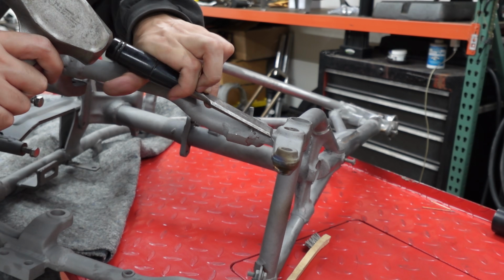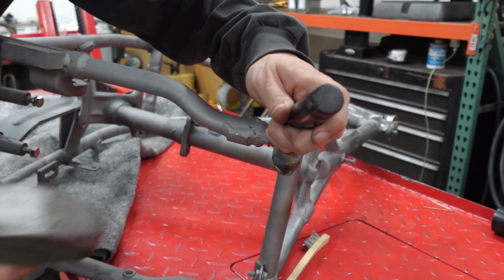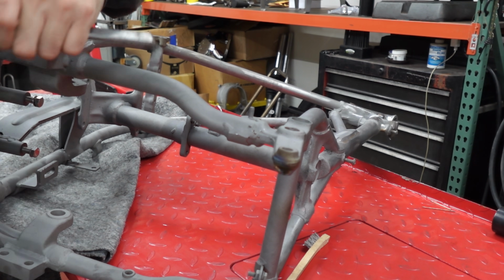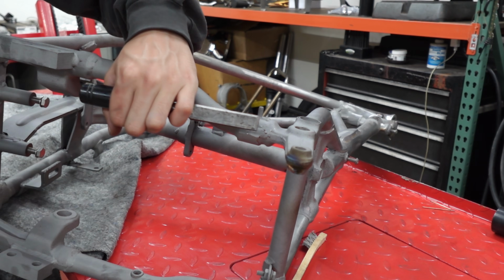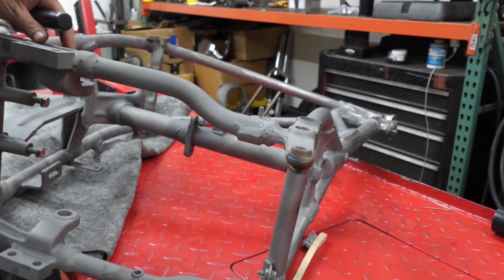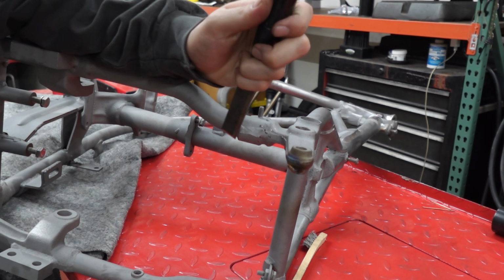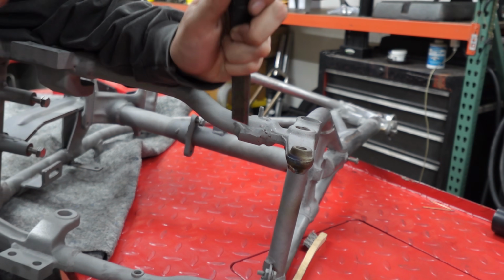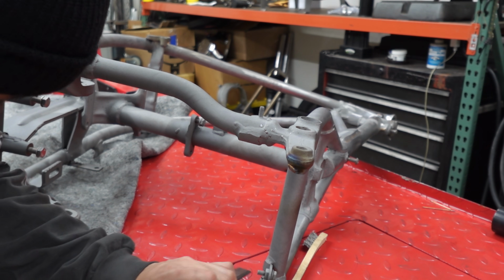That one right there. Yep. Rough. Yeah, I got that one. That one's on there. There it is. And that one could just be ground down. Let's see, just spot checking everywhere. Usually around areas where they weld on these tabs, it gets a little crazy. Yep. Grind that down. Some down here. Pop them off.